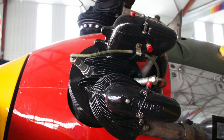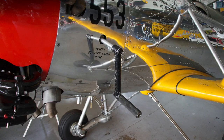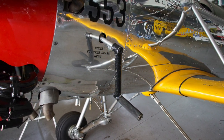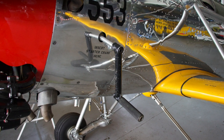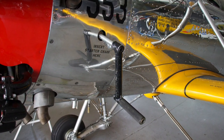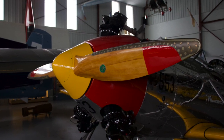Upon shutdown, the oil will then solidify. The Recruit requires two people to start: one to be at the controls in the cockpit, and the other to either hand crank using this crank or hand prop. Since there is no primer, the pilot must exercise the throttle back and forth while the ground personnel walks the prop through, repeating the step 5 times.